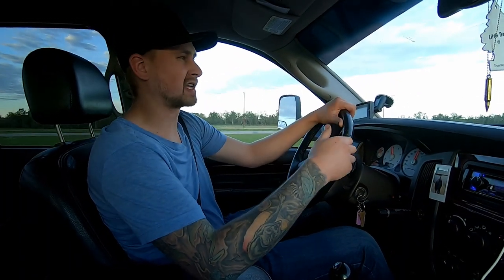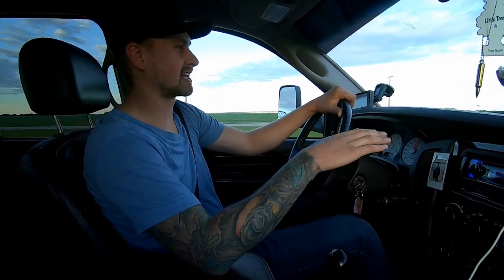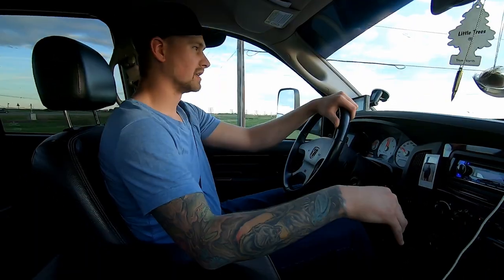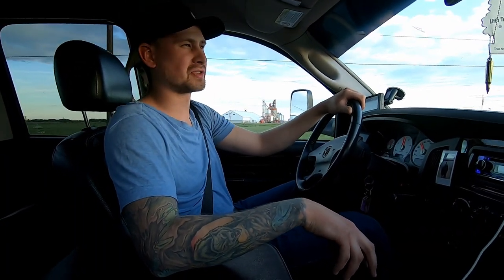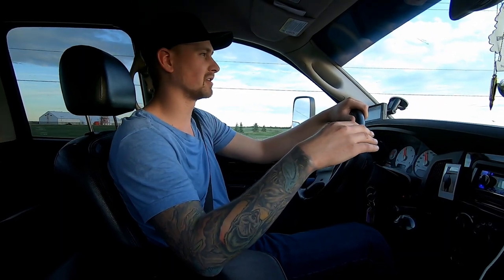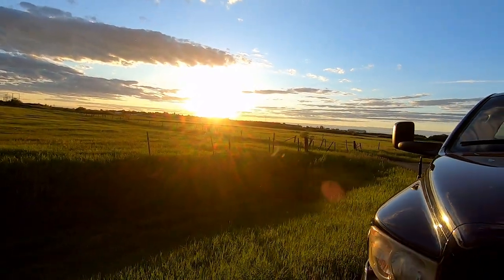We're just driving to this old unused highway to do some more video. One thing I noticed is you can't use cruise control with the exhaust brake on, because without your foot on the accelerator pedal it goes into exhaust brake. On my 2003, it won't kick out cruise control — so your exhaust brake is slowing the truck down while your cruise control is keeping your speed, which is really bad for your truck. I think with 2004 to 2007s, if you put the exhaust brake on the cruise control won't work, or as soon as you flip on the exhaust brake it will cut out cruise control. What a beautiful evening — we're about to disrupt that with an exhaust brake.